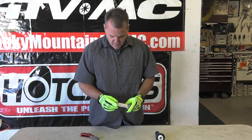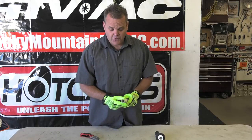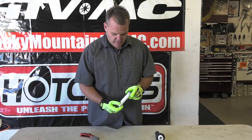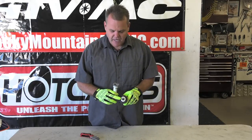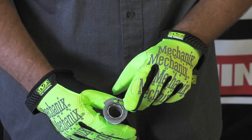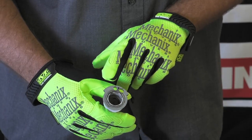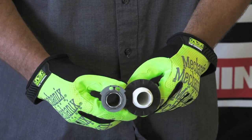Here's one we did yesterday — real simple deal. I actually cut this out and filed it out for an off-road bike that's going to have wraparound hand guards, so this one had been crashed and was already a little bit damaged here. All the throttle tubes, two stroke and four stroke, are using this new design right here. This piece here is for a four stroke because it has two throttle cable openings; the two stroke will only have one. These just pull off and go right on like so.